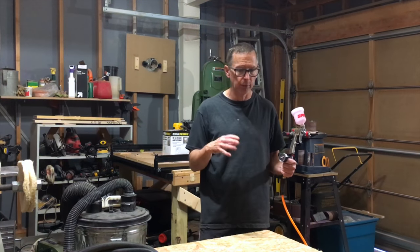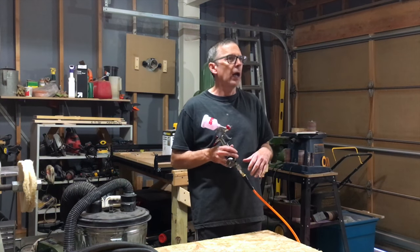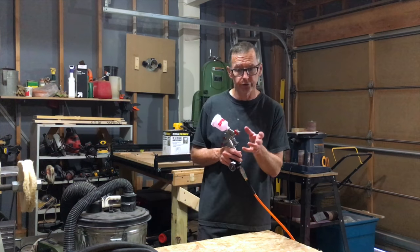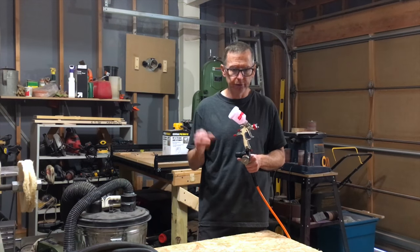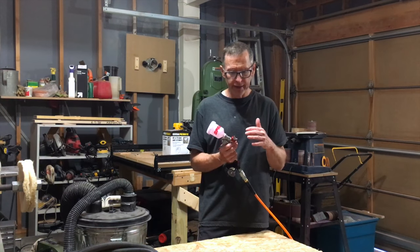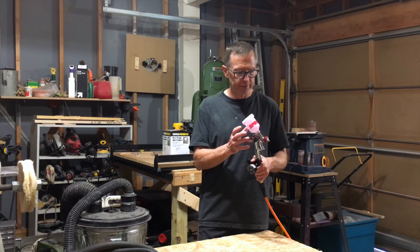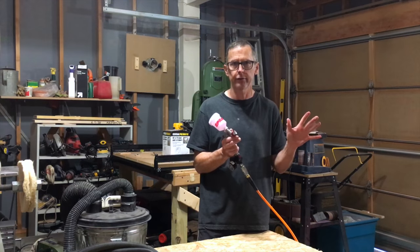Having a regulator at the gun is especially handy if you put the compressor in a different room. Also, if you live in a fairly humid environment or you're using a compressor that requires compressor oil, I would recommend getting a moisture trap to catch oil and humidity so the air entering the gun is clean and dry. That's really important when spraying — if any moisture from the air condenses and gets blown through your gun it's going to hit your paint or clear coat and screw up the finish.